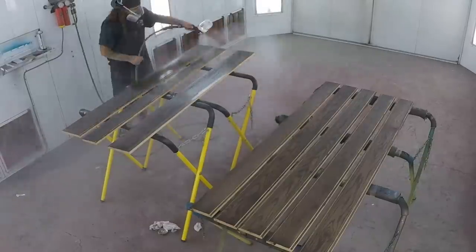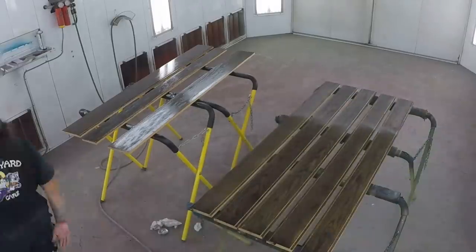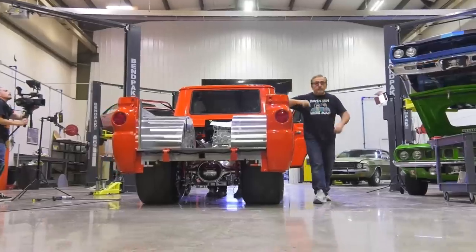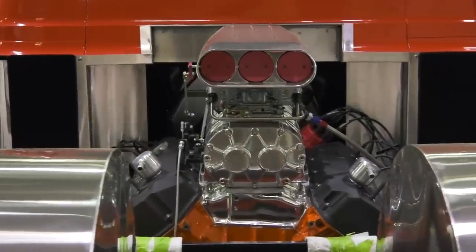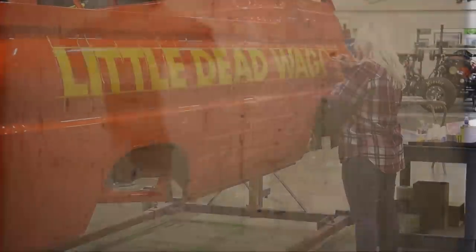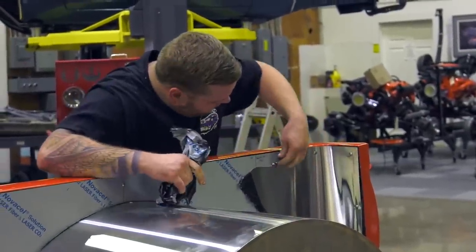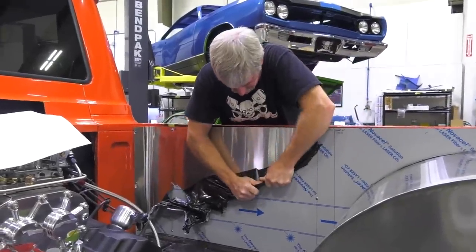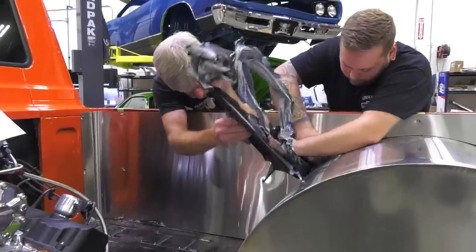When you're talking about clear coating over an impervious substrate like metal, it doesn't take nearly as much paint because the paint has nowhere to go. But this is wood — the stain soaks into it, and the clear is coat after coat. Typically you'd want three or four coats of clear, let it set for a week, sand it, then re-clear and continue until you have a nice flush finish. The little dead wagon has been an ongoing change — from what I originally envisioned to where it is now is different. The stainless steel inside was more of an afterthought; originally I planned body and paint work inside. But as we started running out of time for SEMA, I thought the stainless would look pretty good — and it will, plus it saves a lot of time.